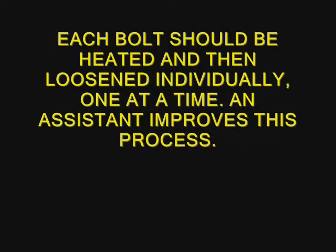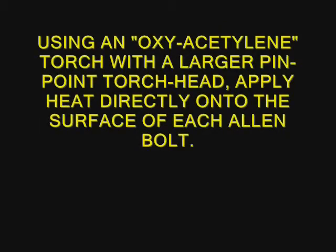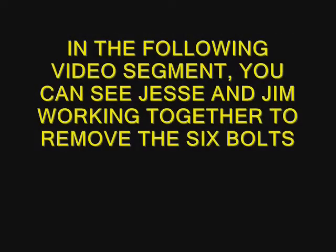Now TRS recommends blue Loctite. So when you're putting this back together, use blue, not green. Blue is a good Loctite with a much lower temperature, and it's designed to make things removable but still hold them. The green Loctite is basically designed for a permanent connection.